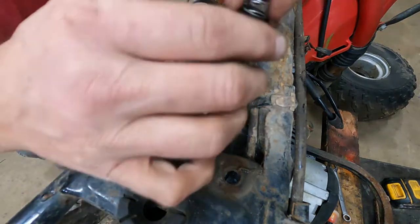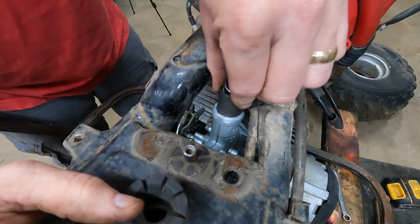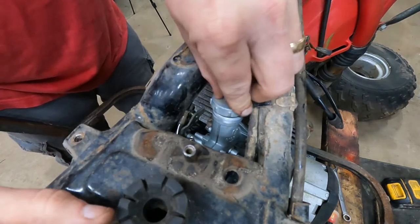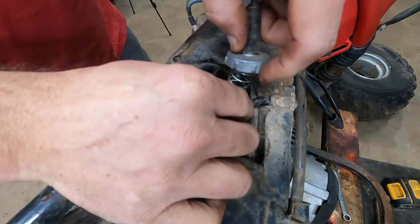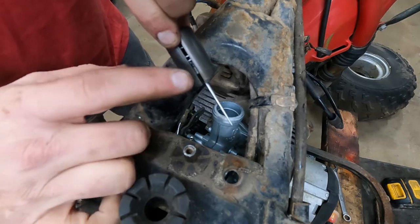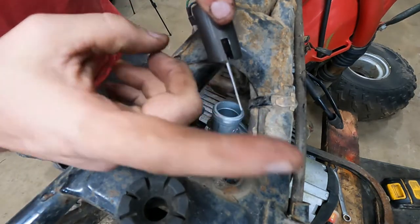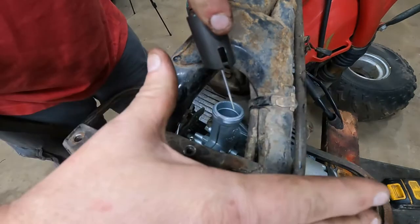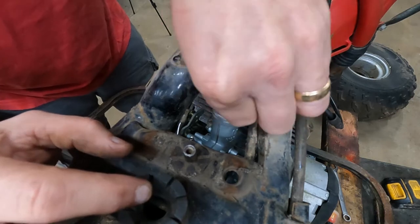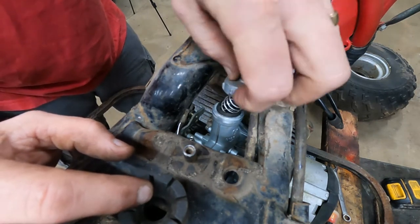So what happens when it's 180 degrees out — you can put it in incorrectly and it sits completely flush, which is what's confusing. You go, 'well, that looks right.' The slide is completely flush with the top of the carburetor, you can force the spring down and it will look correct, but it's 180 out. If you look closely, the ramp is on the wrong side. Make sure the ramp is on the right side of the carburetor — your right-hand side sitting on the bike — lined up with the idle adjustment screw. When you push it in correctly, it drops all the way down and the spring isn't even being compressed yet.